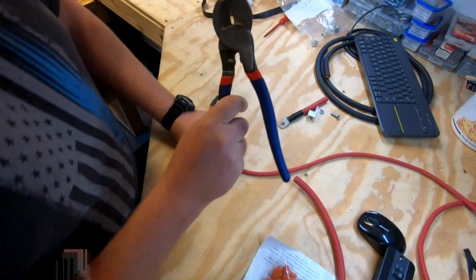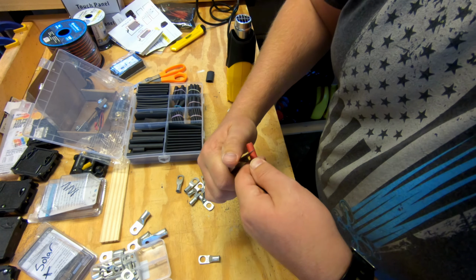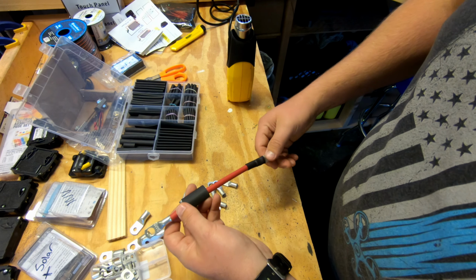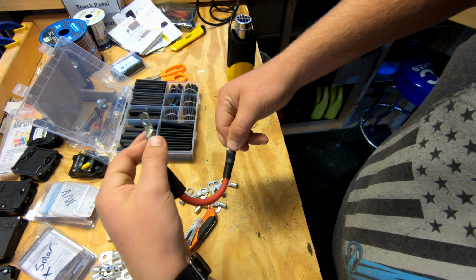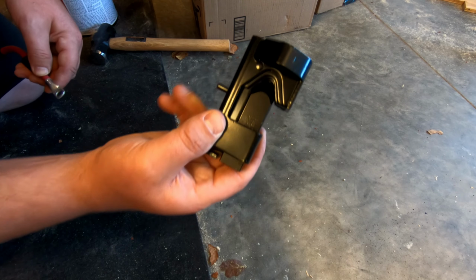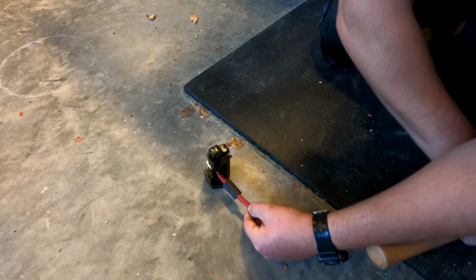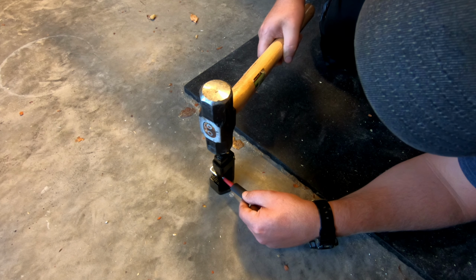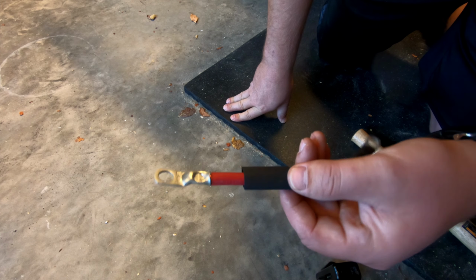So now we're going to cut this. Some loppers. There we go. Heat shrink. We're going to make sure these ends are cohesive, so it's going to make a bend up into that unit like this. So this head isn't this way or this way. It's flat with the other one in this case. Okay. We're going to take our whacker. It's our crimp tool. So we're good here. Right before you whack it, you want to make sure you hold it in. No copper showing. There it is.